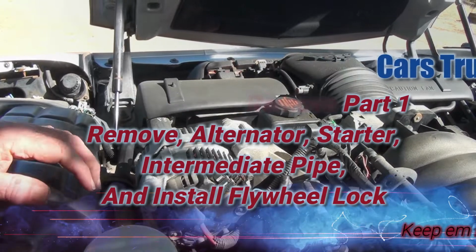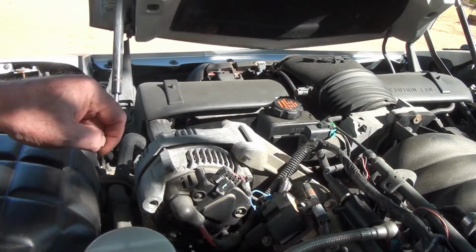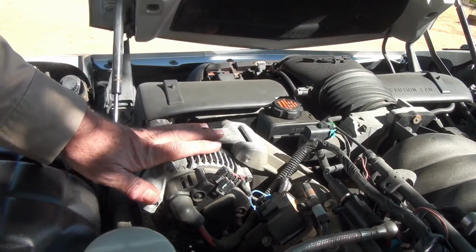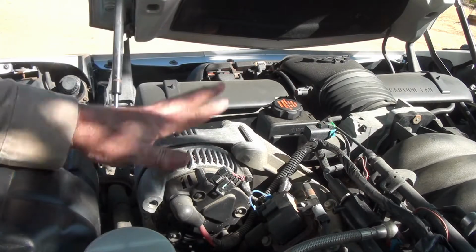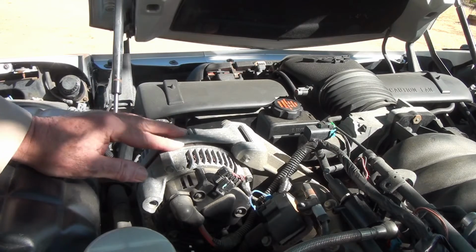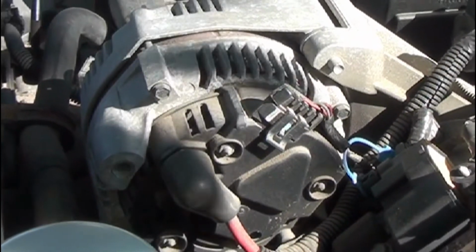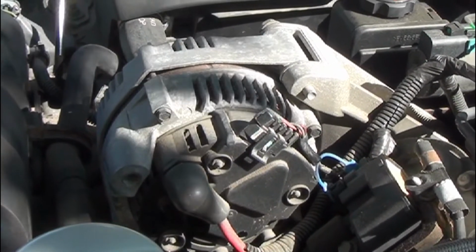I'm going to remove this alternator. The steering rod linkage from the wheel attaches just below the alternator. I can actually see it down in there, but with this out of the way it might give me a little more working room, and it doesn't seem to be too difficult to take the alternator off. I'm looking at what looks like 2 bolts and a couple electrical connections.